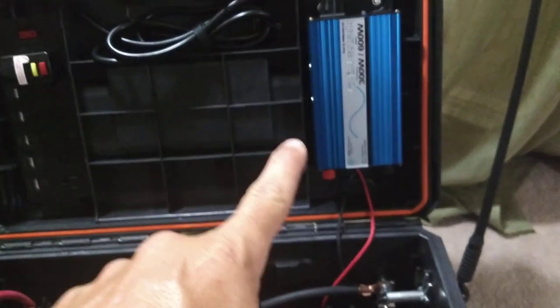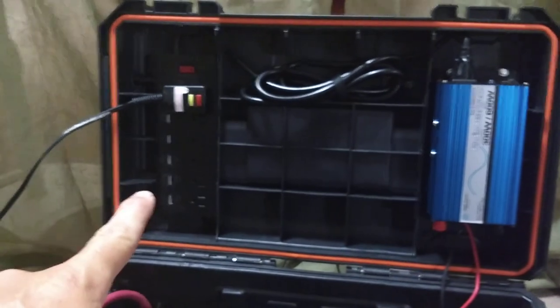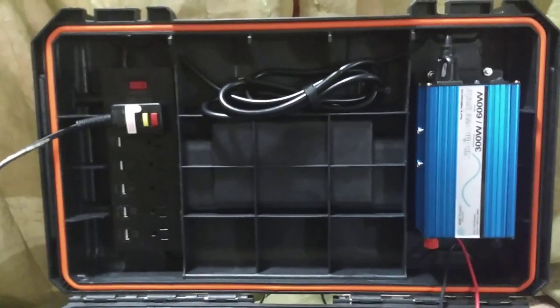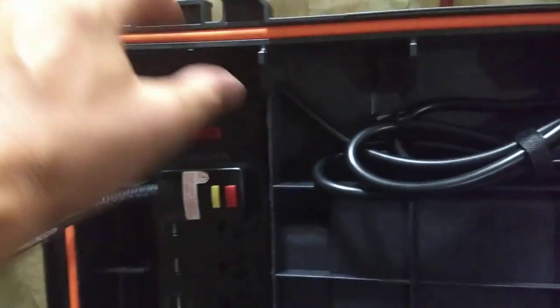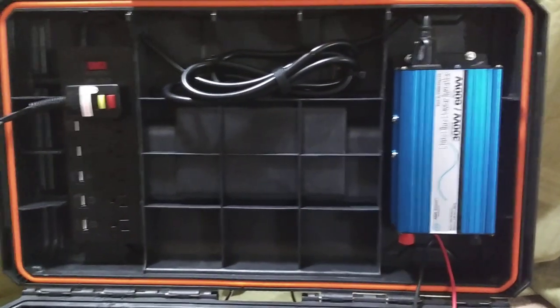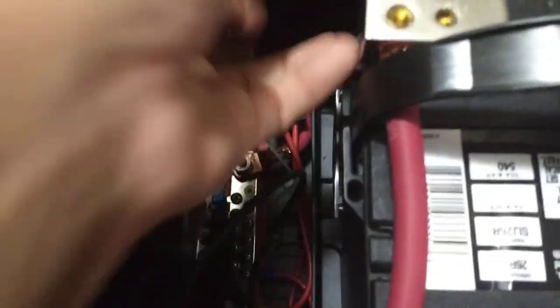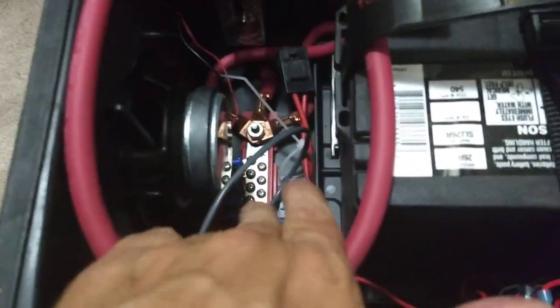On the top right I've got the AC power inverter — this is a 300-watt unit — and that goes over to a power strip, which gives me multiple outlets and USB charging capability as well. The power strip is attached using velcro and some 3M 5200, and this is bolted in using standoffs onto the lid. All of that stuff is off the shelf at your big box hardware store. It's wired directly to the bus bars using an inline fuse because it's a high-current device — an automotive-style DC fuse that goes right to my bus bar.